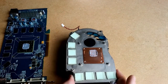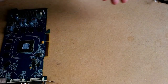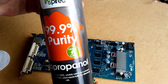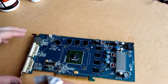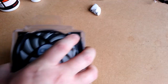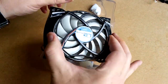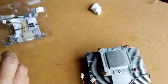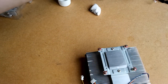So, this is the stock cooler that makes all the noise. Nothing special, but it does have a copper block for heat dissipation. Here we have the HD 3850 in all its naked glory. Now it's time to remove the paste using a cotton pad and some isopropyl alcohol. This is what I'll be using as a replacement cooler — an Arctic Cooling Accelero L2 Plus, which I picked up on eBay for £20 second hand. It's rated to work with this and higher powered cards, so it should do just fine, and it comes with all the bits and bobs.